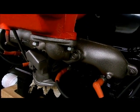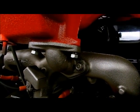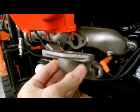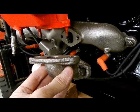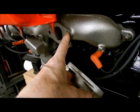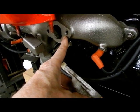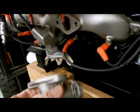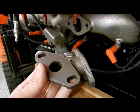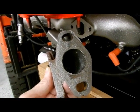The other gaskets are not quite so straightforward, but they're not too difficult. Let's take off the elbow for the carb heat. Here's the elbow removed — the nuts and bolts that hold this on are just half inch. The exhaust manifold bolts can sometimes give a wrestle because they get seized after years, so remember you're only talking about a half inch and they're easy to break off. As you can tell, the top side has a smaller hole compared to the bottom side, and that's where your gaskets come in.